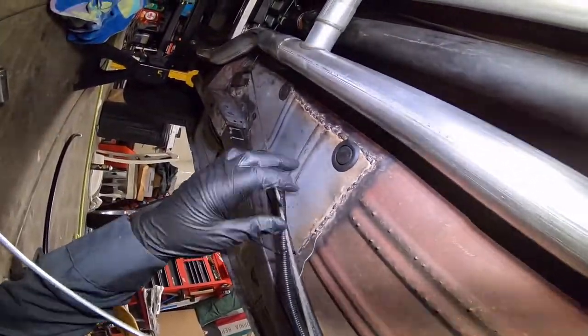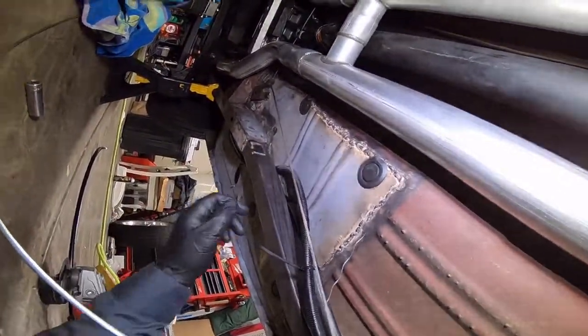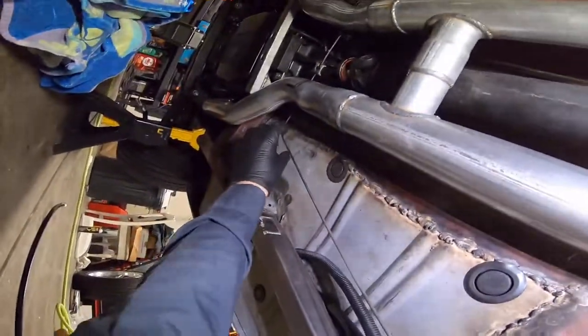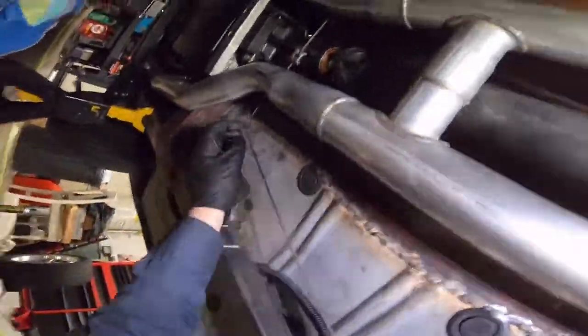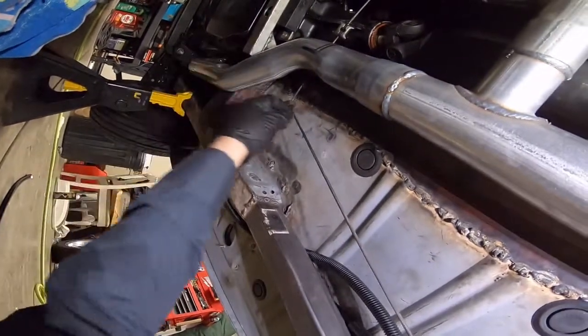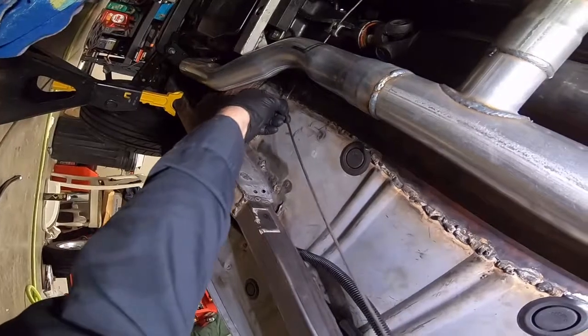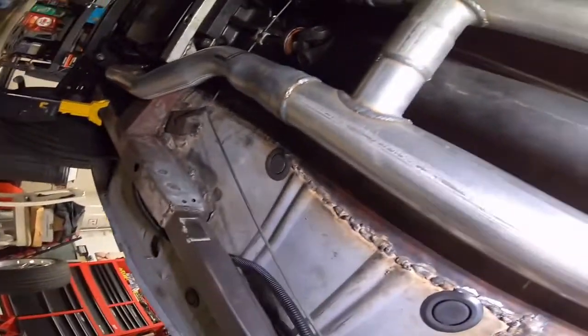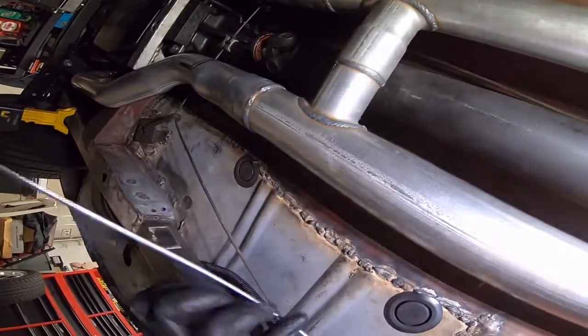And I got some fraying here on the original cable, so I'm gonna try and cut up above it. You wanna pay attention to where you put those couplings. For example, you don't wanna put one right here, because when the cable gets pulled, it's gonna pull the coupling and it will get jammed on this hook here. So just pay attention to where you're putting your couplings.